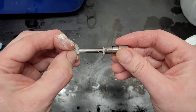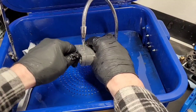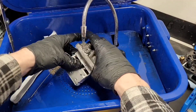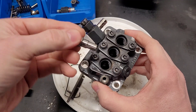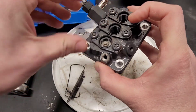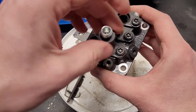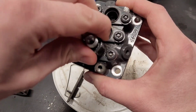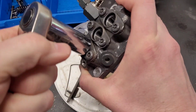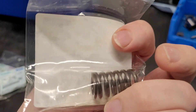I got that cleaned up and I think the plunger's good — just had some deposits in there, but it definitely needed to get unstuck. I went ahead and got three new springs for the injection pump. Let's get them put in.